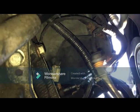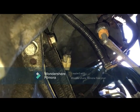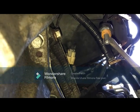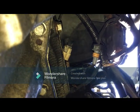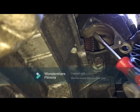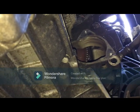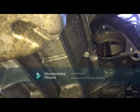And then the knock sensor. Actually this is not the knock sensor, this is the solenoid. The positive for the solenoid, and then this is common ground. Never try to short these two together. Remember, sometimes you may leave the negative side out. You're working on the starter, you have an engaged e-brake, you have the car lying flat with no wheel supports. What can happen is, by accident, you put the new starter in. This is the crankshaft, and by accident you touch this somewhere, like on the car body. You'll engage that starter with you still under here, and you do not want that.